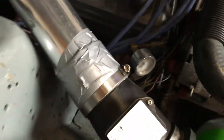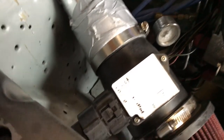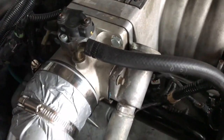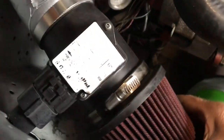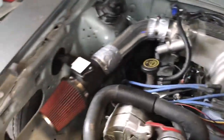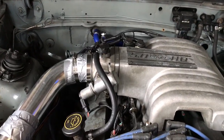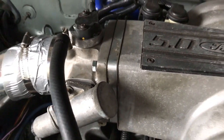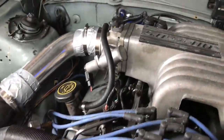There's the Bullet Pro-Am mass air meter — I'm going to have it recalibrated. There's the bigger throttle body right here, it's a 65 rather than a 60. Everything's nice and solid here. I had a few little leaks but taped them all up. Bigger throttle body, bigger mass air meter. Replaced the spacer plate with a smaller one — actually bigger diameter though.